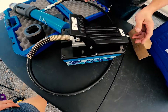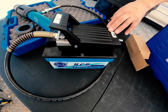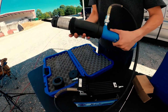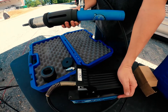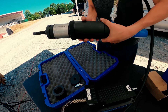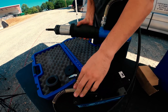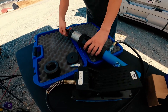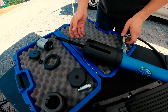Then you need to connect the airline to the back of the pump. This is the oil pump which will provide oil to the cylinder, and the cylinder will decompress in order to pull the bracket bushings from the bracket. You need to push on the back of the pump and the cylinder will decompress and pull the bushing into the adapter. When you remove the used bushing, release it and the cylinder will push it out of the adapter, and then you can safely remove the old bushing.